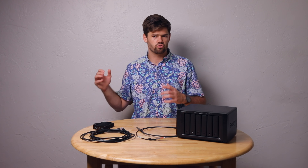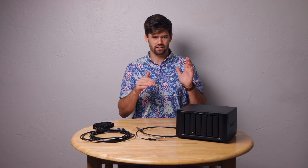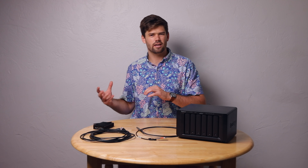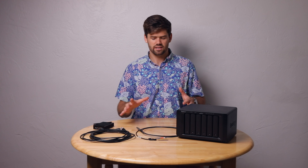Now your computer will be able to talk to your NAS at much faster speeds. This is really going to help if you're video editing or dragging and dropping huge files to your NAS — you're going to get much better throughput. I'll leave Amazon affiliate links in the description for all the different hardware for basic 10 gig setups, because the different types of 10 gig interfaces make it really confusing if you don't know what you're doing. Remember, if you just want to simplify everything, get 10 gig RJ45 10GBase-T and it should work with just about everything. Go ahead and leave any other tutorials you'd like to see in the comments below.